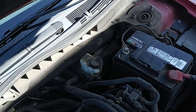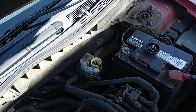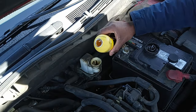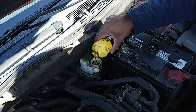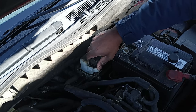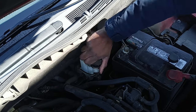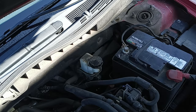The last thing you want to do — and this is most important — is top off the brake fluid reservoir. Open it up. Remember, you're going to lose a lot of fluid, so just top it off. That's why we bought new brake fluid. You don't want to overfill it — you want to keep it to the max line. Just top it off a little bit, not too much, then cover it back up. And that's it — now you're good to go.